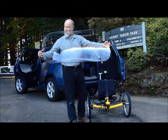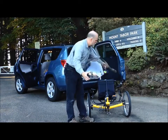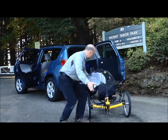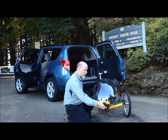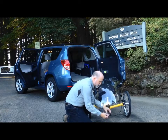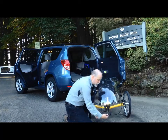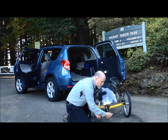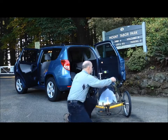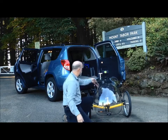All you have to do to put it on — you see the four black rubber swell nuts. Those are what hold it on. You put one in the top, second one in the top, and then two go in the bottom, a pair down here in the bottom. Put them in. The fairing is in, but it's not tight yet. We're going to give them a couple turns, tighten those on, and lock everything in. There we go. Fairing's on good and tight.